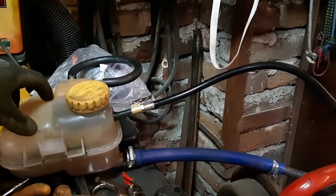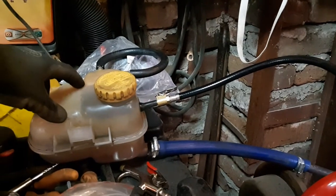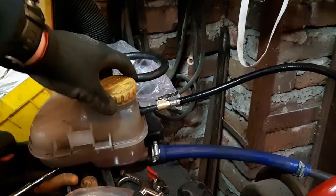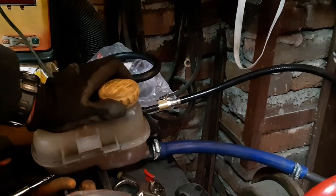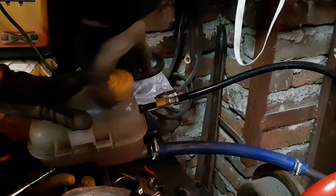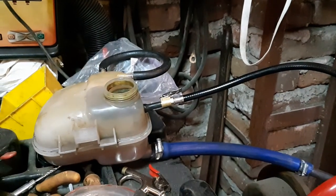That's how you can test your system. You can also test for leaks when you pressurize to 1.5 bars — for example, this one has a little crack here, so a bubble started coming out when I pumped the system. That's how you can check your cap and your coolant system as well. Hope the video is helpful and I'll see you on the next one, bye bye.